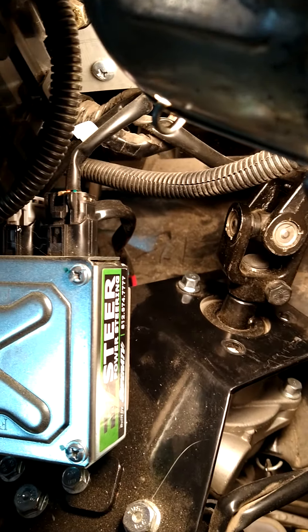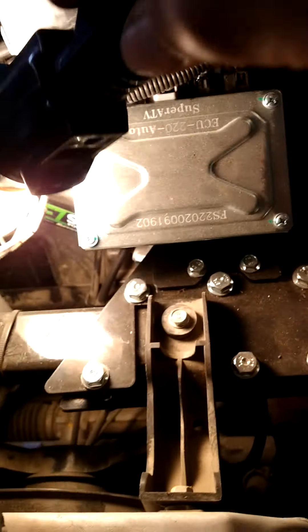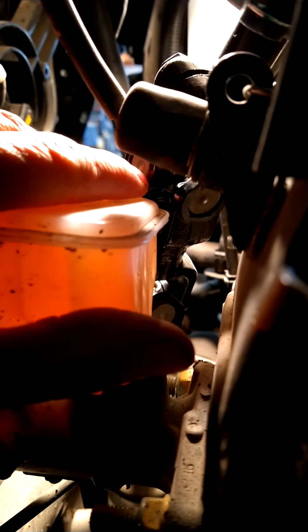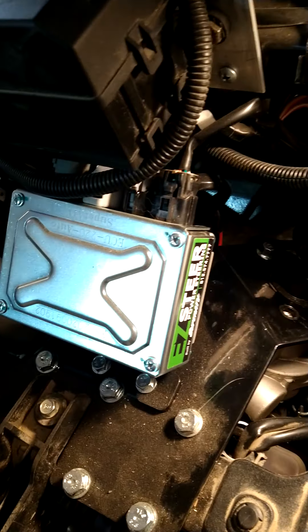In my case, all the way to the left, this bracket does flex up and down big time. If you look down here, this is your brake master cylinder, and right here is the steering knuckle. When you bottom it out, it flexes. I don't think they can do anything about preventing this flex because there are four joints in it. In my case, it was hitting the master cylinder only when you bottom out, and to me that's going to do damage. That's not acceptable.